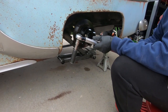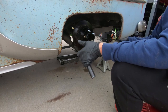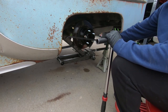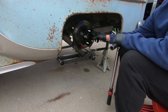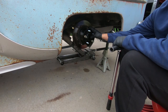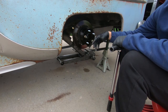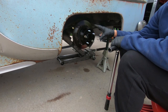To torque these things, I'm going to go to 100 foot-pounds — it's really based off manufacturer specs. This is an S10, so I'm going off what I normally do on an S10. You don't want to go over 110 because you might risk cracking it. Now, with that being said, you do need to re-torque these. Drive about 25 miles, take the wheel off, and re-torque them. If you have any loose ones, torque it probably every 25 miles until you don't have any loose ones. Then obviously we'll take it down the road and make sure everything's good. I'll time-lapse the other side.